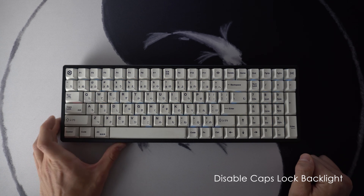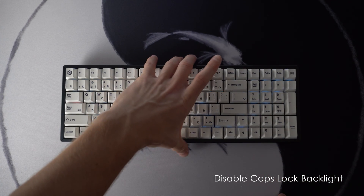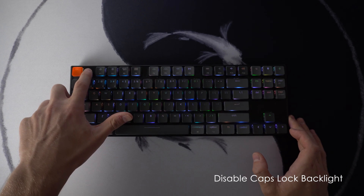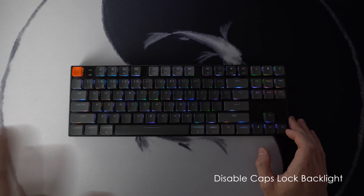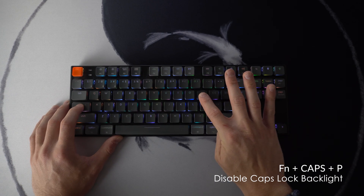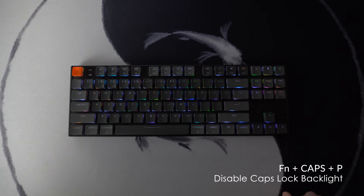Here's another handy one for changing the caps lock backlight behavior. Normally when you hit the caps lock button, it lights up red to indicate that it's activated, but this might conflict with your color scheme. You can turn off this function altogether. On the K1, it's not as relevant because it's already got a caps lock indicator in the corner. However, you can disable this function altogether by going to Fn, caps lock, and P, holding it for four seconds until it flashes red. Now when you hit the caps lock button, it won't conflict with your color scheme. This doesn't work on the K4 V2, but it's known to work on most of the other K series keyboards, including the K4 V1.